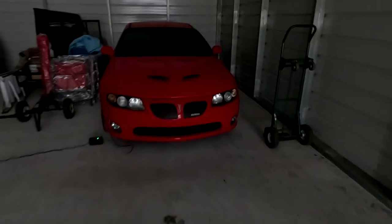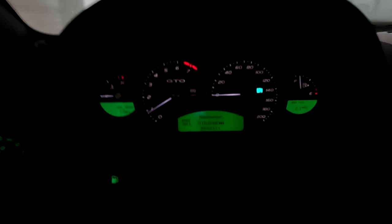There she is. I love this car. Just in case you missed it — hear that roaring noise? If I make a right or left hand turn... I have two wheel bearings but I really don't want to do both of them. When I did the bearing on the left side, the driver's side, I didn't mess it up, but I do have to put the clip in there. See, it gets quiet when I turn — that's the wheel bearing. If I go left or right, if I turn left it gets quiet.